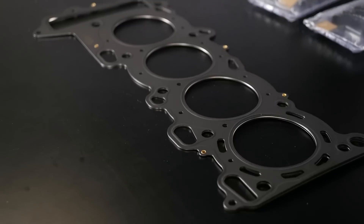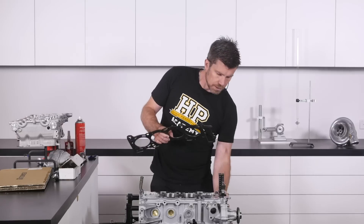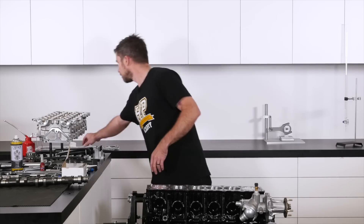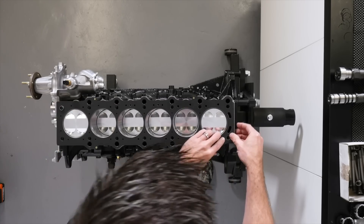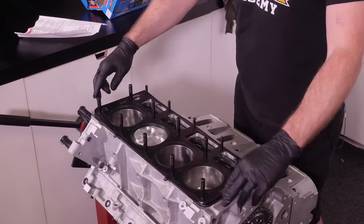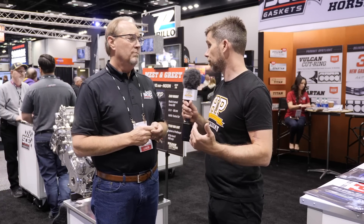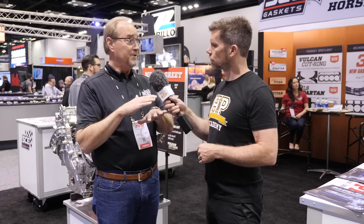The composite gasket was nice in that it allowed us to seal oil and coolant quite easily. That composite construction style was good for compression ratios of 8:1, maybe up to 10.5 or 11:1, and then around 12:1 they begin to fail because there's just no backing to the combustion seal there — nothing to stop that combustion pressure trying to push out through the composite gasket when pressure gets high enough. When you begin to lift the head a little or unload the clamp load, the web strength of the gasket wasn't there to prevent it from just pushing out.